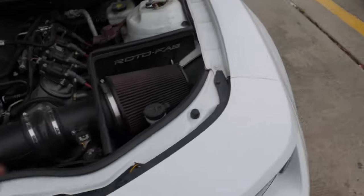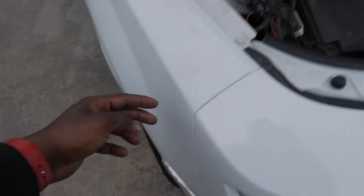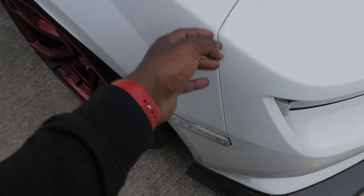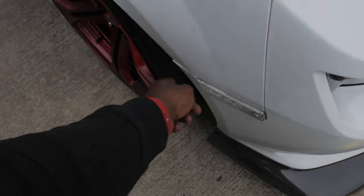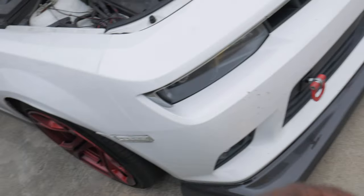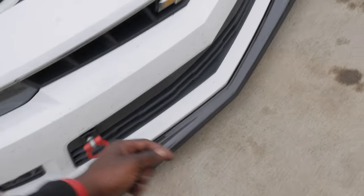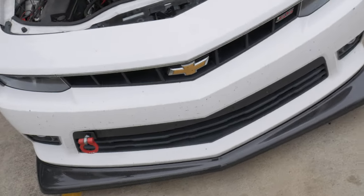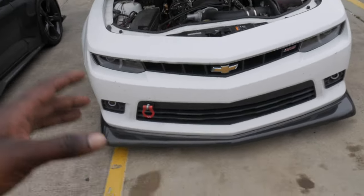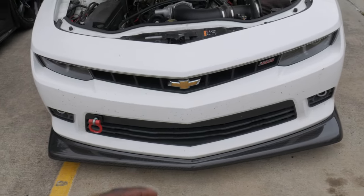When taking off the front bumper, you basically have a bolt right here. You have all of these push-in tabs, a bolt right here, and then there's three 10-millimeter bolts that go along the fender. The front bumper has a 7-millimeter bolt right here and a 10-millimeter bolt right there. Then you'll have two 10-millimeter bolts at the bottom of the bumper as well. Take all of them out and the bumper comes off. I've done this so many times — I'm not going to show it on camera, I'll cut back when the bumper's off.